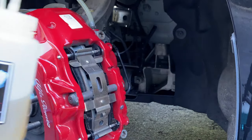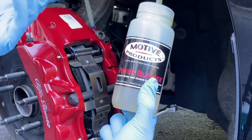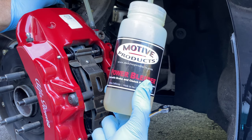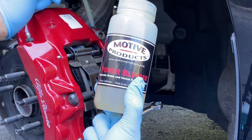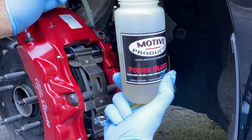This one's good, it's flowing. There's a lot of corrosion I see as I crack open the bleeder, and that's what we want to get out of the system — any water, contamination, or corrosion. The brake fluid itself is very corrosive, so inside the brake lines there's most likely some coating breakdown. Four years old, things are starting to get degraded, and that's why it's definitely smart to do this now.